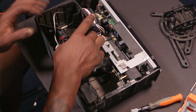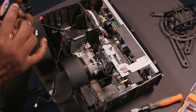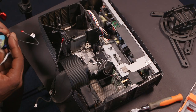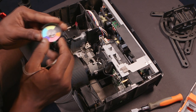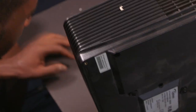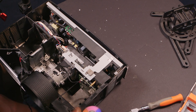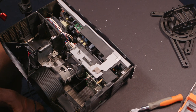Finally got the color wheel out. It appears there's not really much wrong with it — just some smudge marks — so I'm going to try and clean it. There's still glass inside here from when the bulb broke and even a dead moth. My bulb had exploded when it broke. So I'm going to clean this color wheel, give it a test. I'm pretty sure it's not going to work still, but I'll give it a test anyway just to see.